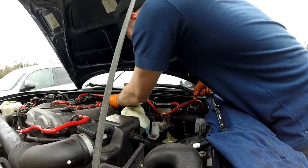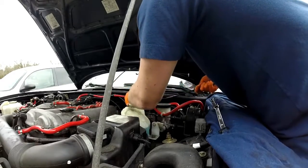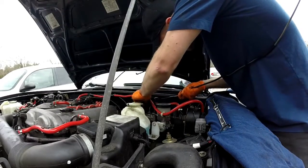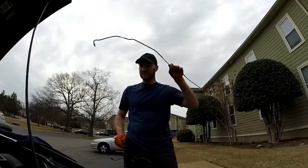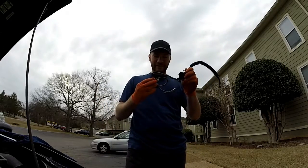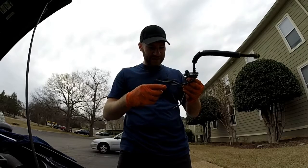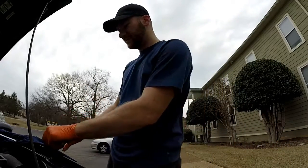It got caught on a wire — it's going to get caught on a lot of things, so just be careful, don't rip it out. There we go — it was kicking my butt there at the end. The long line is on top of the vehicle, then it connects to this piece here, goes down towards the slave cylinder, and we have this wire line. This was mounted somewhere, but on my car for some reason it's just hanging loose — no idea why. I had a zip tie here and a zip tie at the bottom of this mount, so I just cut those off and pulled it right out. Now we just need to take the slave cylinder and master cylinder out and start getting the new stuff ready.